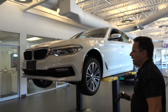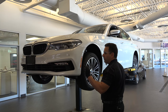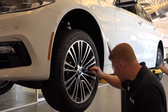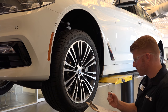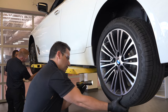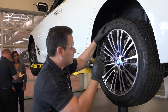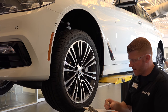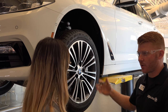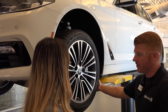Now what Matt's going to do is take a tread depth — he's going to measure the depth of the tires and write them down. He's also going to see how much pad you have left on your brakes, and I'll be looking at the condition of the rotor. Brenda, looks great. So as Mike had mentioned, a couple of things that we want to check for you during this inspection is the thickness of the brake pads, how much brake life is actually remaining, and then the same for the tires — we want to make sure you have sufficient tread depth left and a nice even wear pattern. Everything looks great.